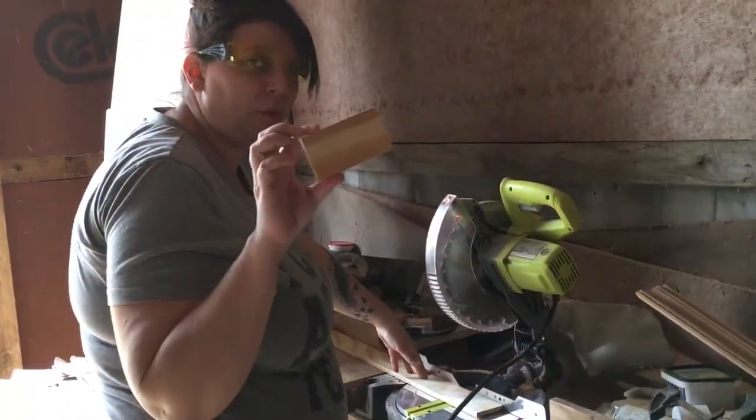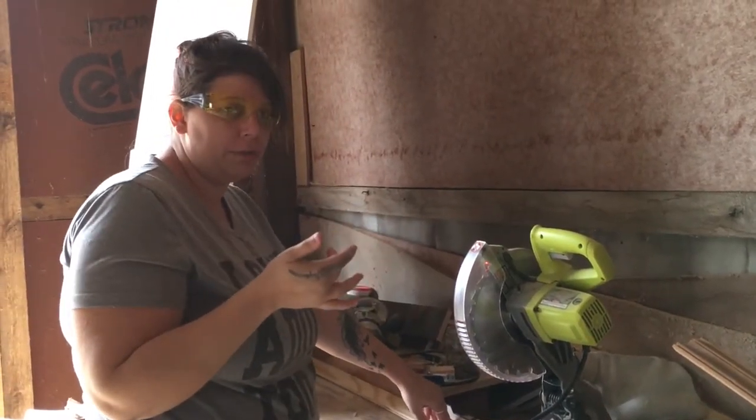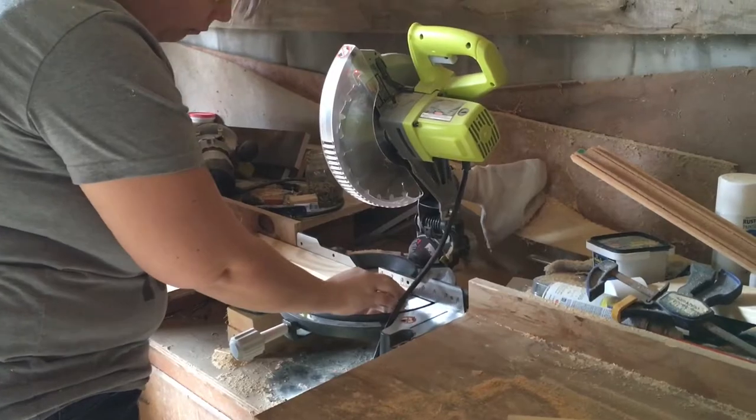I'm making these four-inch strips that are going to go across the room, because there are ribs in the bus and since there's such a sharp curve, we can't just bend the wood without altering the wood. We are going to have to make another trip because I did not have any more wood saw blades for my jigsaw, and so I cannot cut the round contours of the frames for the skylights into the ceiling.